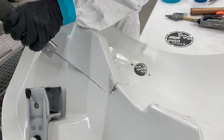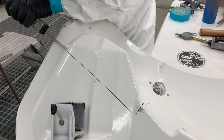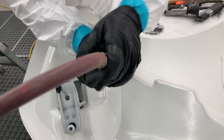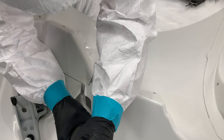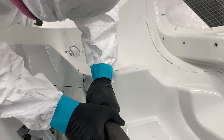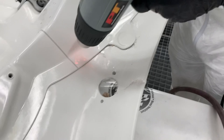We're also going to show some other things in this video simply for demonstration purposes that you may not necessarily do on your own repairs. Fiberglass cuts very similar to wood, which is why I'm using a reciprocating saw rather than a cut-off wheel. A coarse blade works much better than a finer blade made for steel. A hacksaw can also work well for cutting fiberglass. In fact, if a hood needs to be discarded, one of the quickest ways to cut it up is with a chainsaw, watching out for any metal reinforcements.